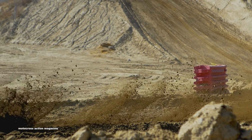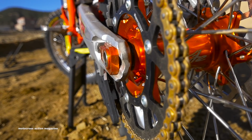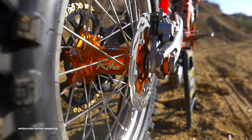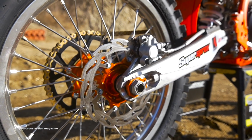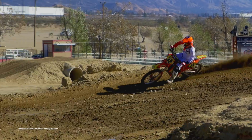The worst thing about the KTM 250SXF in stock trim is its gearing. Luckily, it's an inexpensive fix. The ultra-tall 14/51 gear combo was replaced with a Super Sprox 13-tooth front sprocket and stock 51 rear. Bringing the countershaft sprocket down one size is close to going 3 teeth bigger on the rear. The gearing is that far off.